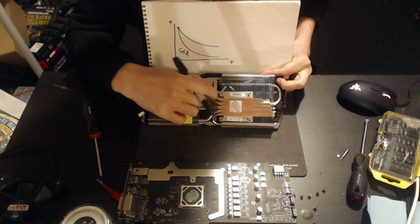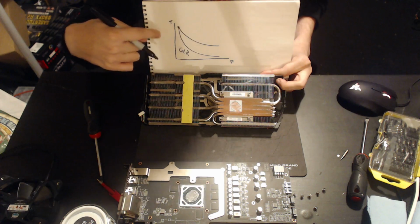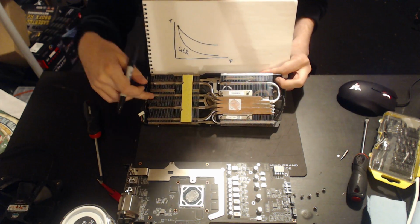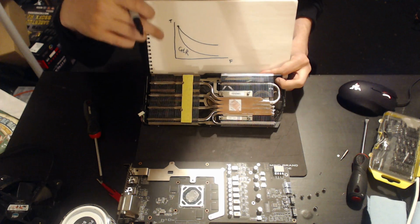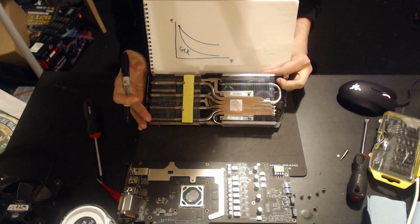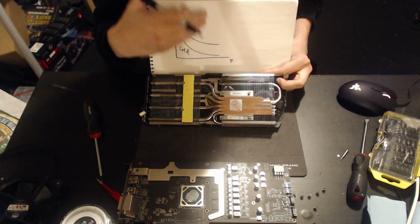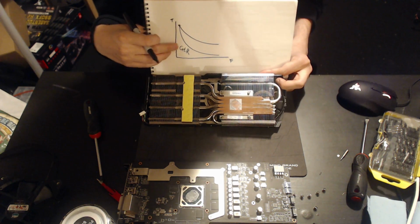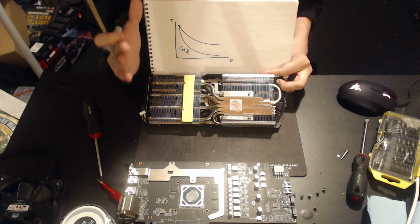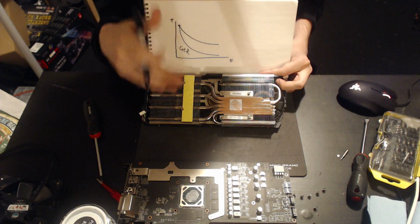And that leads me to think that there is an issue, and I really need to do something about that glare. There is an issue with this sort of heat pipe layout, because the fan speed for both cards is the same. This card has a bigger fin stack. This card also has more fans on it. This card, theoretically, should have way better cooling performance, but obviously, it's not dropping temperatures as quickly as the GTR. Why is that? Well, I'm going to investigate that, but I'm also going to tell you what I think is happening right here, right now.